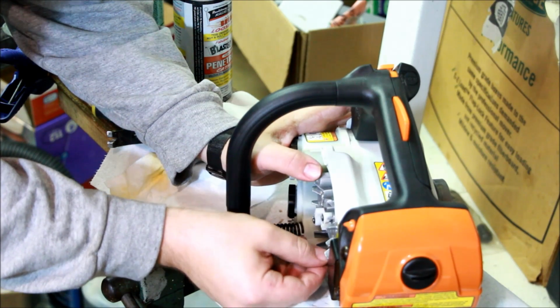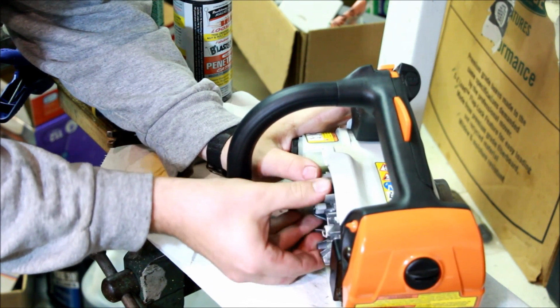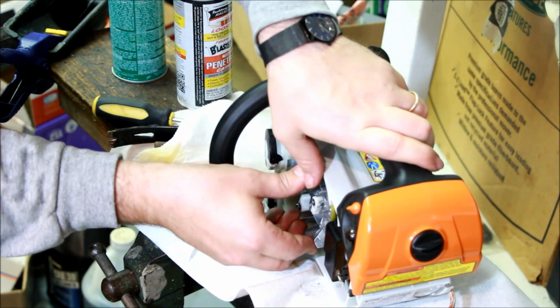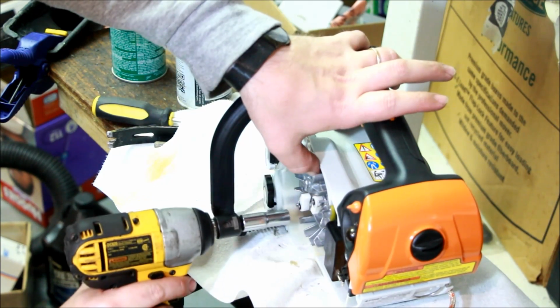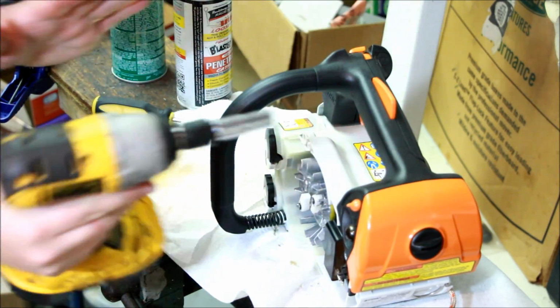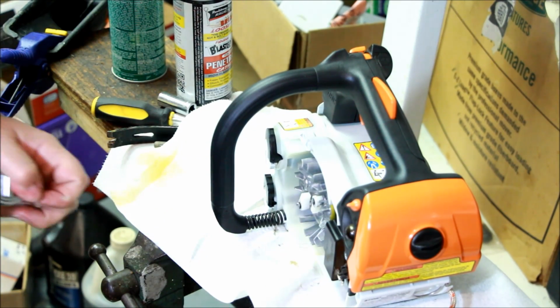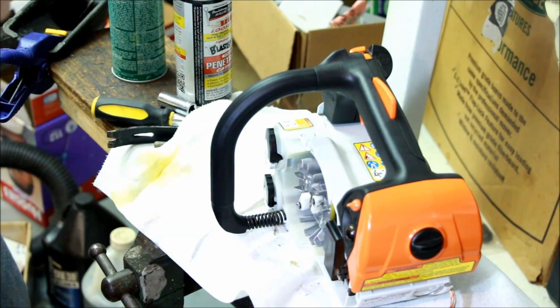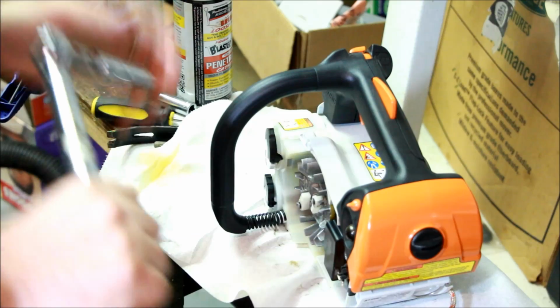So this now moves. You can see that. So I want it in, but I want it held against the forward part of the advancement here. Hold it against the stop. Now, I'm not trying to go tight with the impact. That's not the idea. You just want to get it started. And I don't know the spec on this saw, but I'm going to use 10 foot-pounds because this is smaller. Let's use 10.